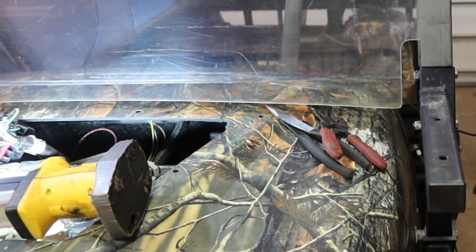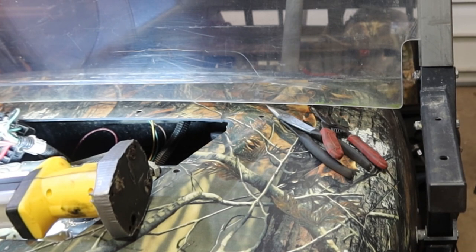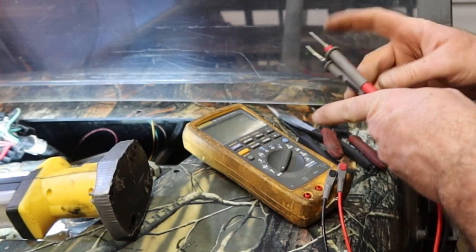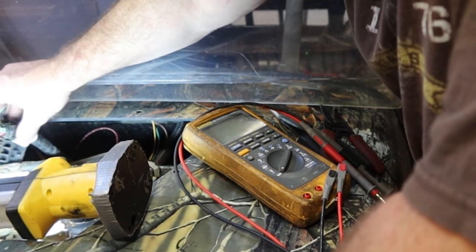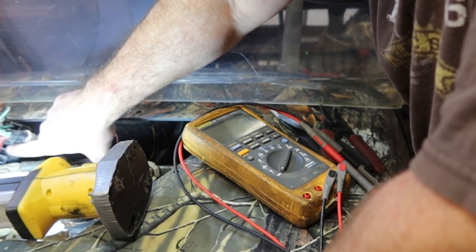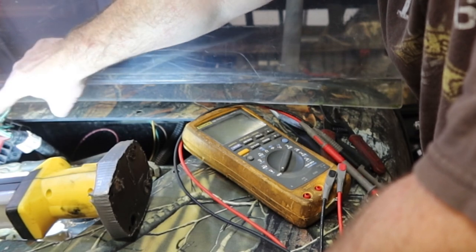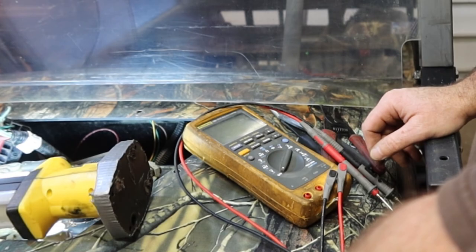So, how do I handle this? I can use a relay to control that side of the circuit. There's a couple different options I guess we have. We could switch the ground, so that the key switch runs to the ground. As of right now, if I'm hooking up lights to this thing, I want to be using this side of it because these are all 12 volts. Up here is 50 volts. All of these six are 50 volts, at least in relation to whatever they're hooked up to.